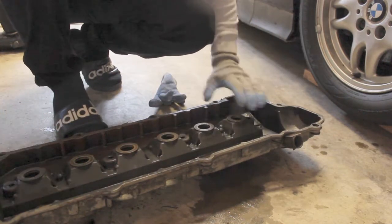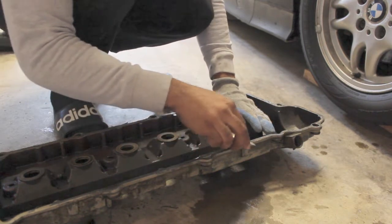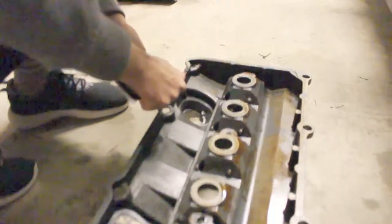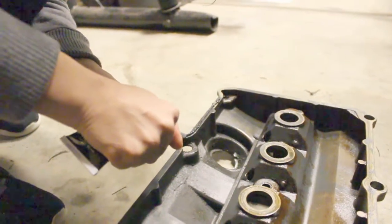When you're going to put this back on you want to make sure your edges are nice and clean, so I got a little razor blade to get all the little blemishes off. This is the permatex, guys. A lot of people don't use the permatex on M50 motors or M52s mainly because BMW spec says you don't need to. But what I have found is that sometimes the valve cover itself warps a bit, and you need to add a bit in there because it's not a completely perfect leveling surface — so you need to add this.